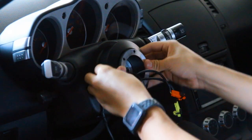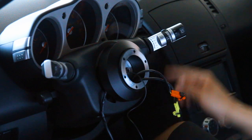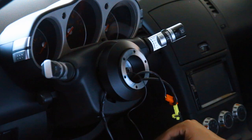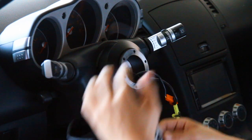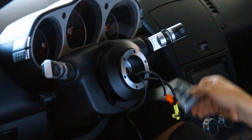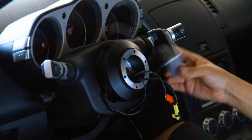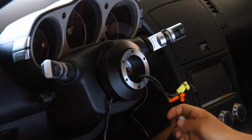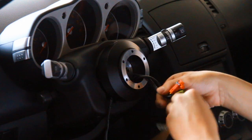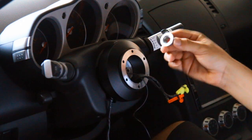Your short hub should be pretty snug and tight on there because of that rubber piece, and the lines should line up. We're going to leave our cruise control on the outside so that we can wrap it around — it shouldn't get pinched. Once everything's on we're just going to wrap it around and have it stick with some double-sided tape. Once you have your NRG short hub lined up and all the wires are where you want them to be, you can proceed with putting the nut back on.